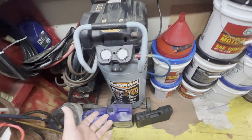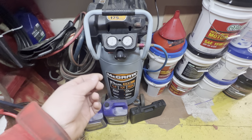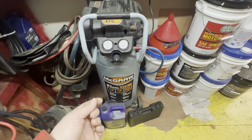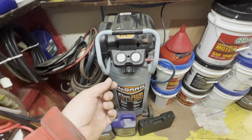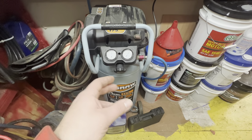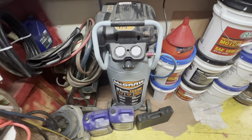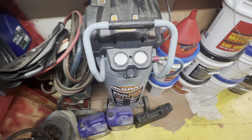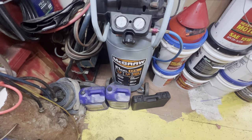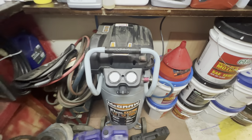I need to get a bigger compressor — maybe a 30-gallon, or maybe 2 horsepower. There just isn't enough air volume. For a full-size crew cab long bed pickup truck it takes about an hour and a half because I do a really thorough job — I get inside all the nooks and crannies, inside all the frame rails, spray every hole in both directions, and really load up the cab corners. It would probably take only 45 minutes if I had a higher CFM compressor.